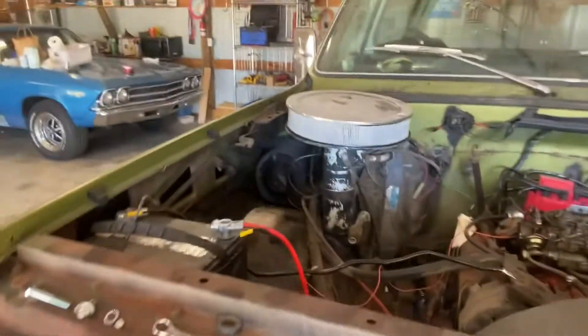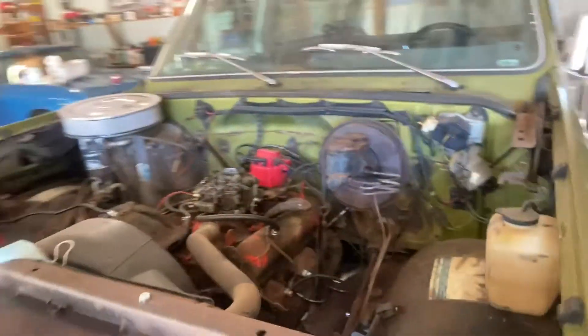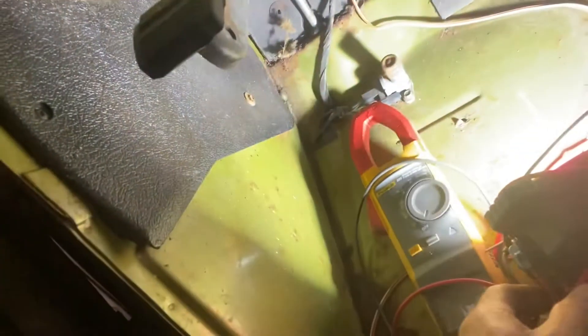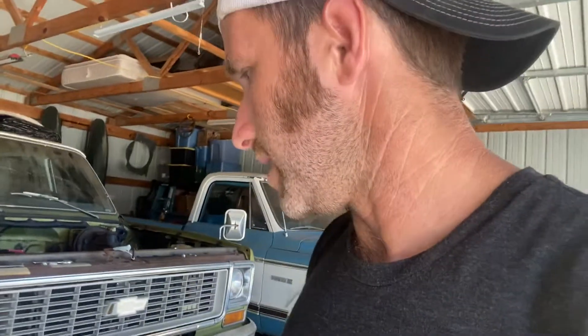What I'm doing now — I put a new positive and negative on here. I just got to run that 12-volt wire and fire this thing up. The ignition is 12-volt; I just got to put a little spade connector on it and run a new wire. What I usually do — I just parted out that 2500, that black Chevy pickup. I saved the harness out of it. I'm going to remove the right-size wire I need from that. It's good wiring, and I'm trying to save and reuse it. It'll be nice and clean and it'll work.